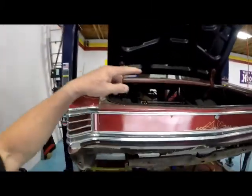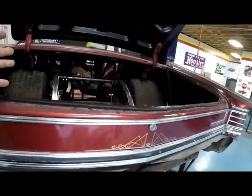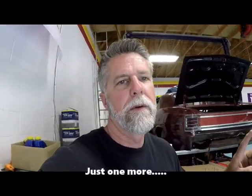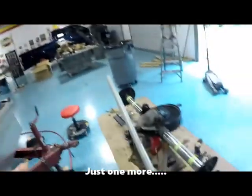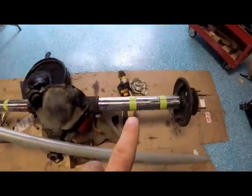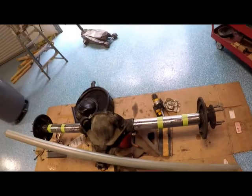We'll go from there. I took the measurements before by crawling up inside, measured from the inside of the rim to the other inside of the rim, and got it that way. But I just want to take one more measurement, verify that outside of 72 1/4, and then I'll be much more comfortable and ready to cut the 5 inches out of this rear end. Because let's face it, I can only do that one time. I could weld metal back, but nobody wants to do that. That's not fun. All right, let me tear this thing apart, and I'll be back in a minute.